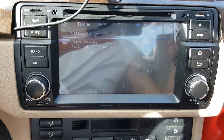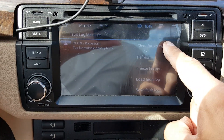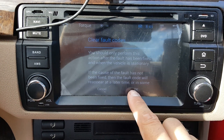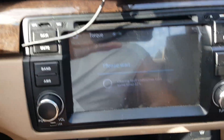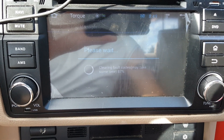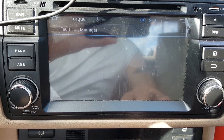Then go up here and hit your little three buttons — Clear Faults. It says don't do this when you're moving. Hit the OK button. Done, just like so. Takes it a few seconds to go through, but then it'll come back and say done. You'll see nothing in the list anymore — completed, no more faults.